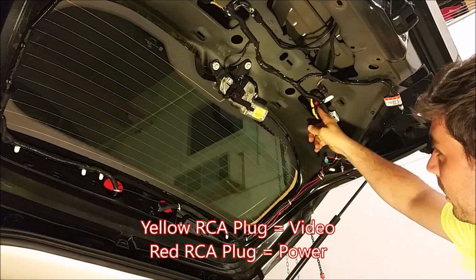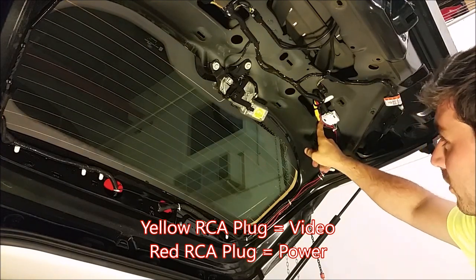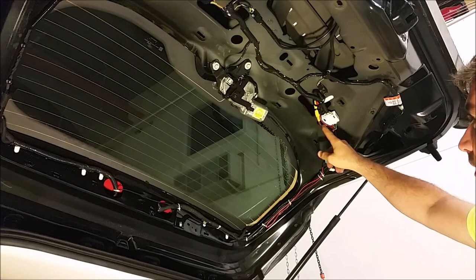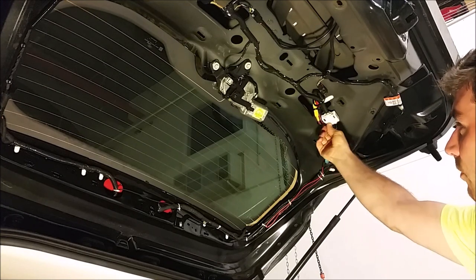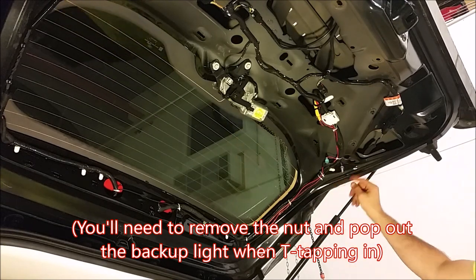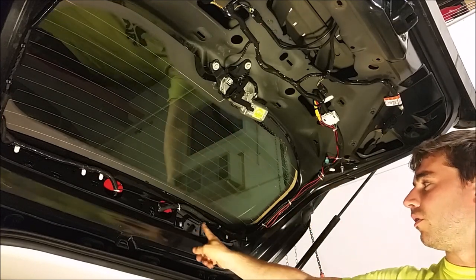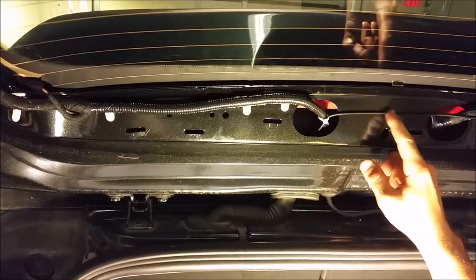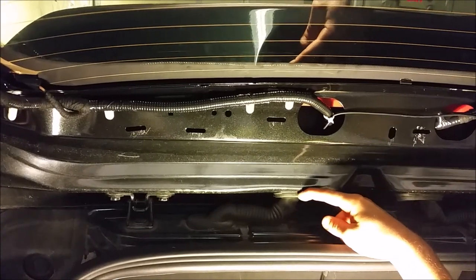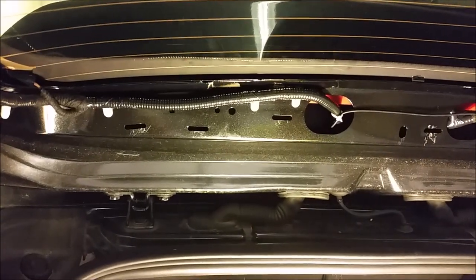Here is where our camera wires come through. You have your two RCA connectors — yellow and red. Yellow is the video that goes up to the MyFord Touch; that's your positive and negative coax. Red is your red and black power wires. So I ran the wire up, fed it through the hole, tapped into the positive lead of the white backup light, then took the coax cable and routed it all the way across with zip ties. Here's a continuation of that coax cable going in, feeding out down here. I popped this boot off and fed the coax line through the boot, and then it comes out in the cabin.